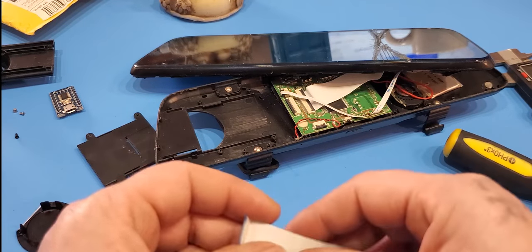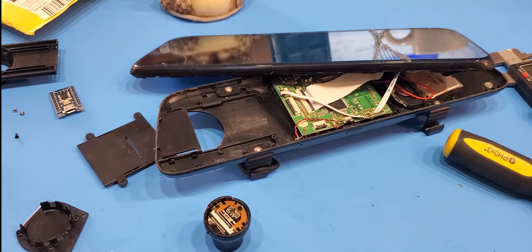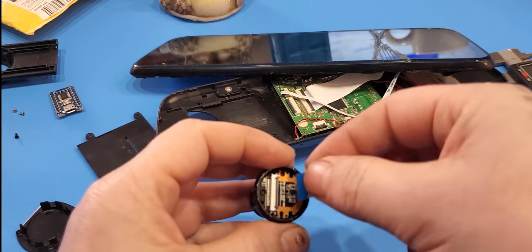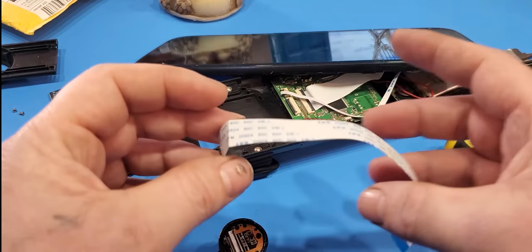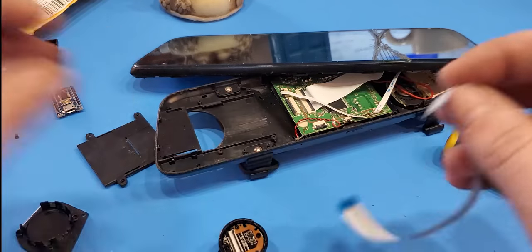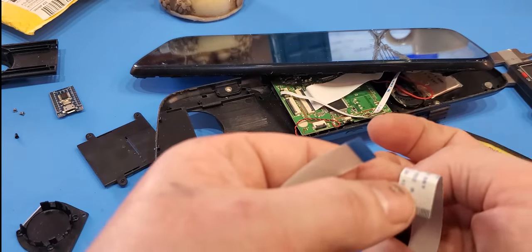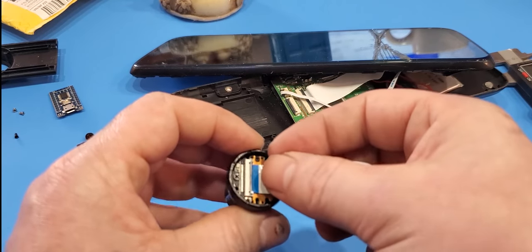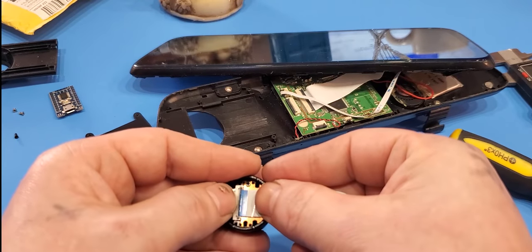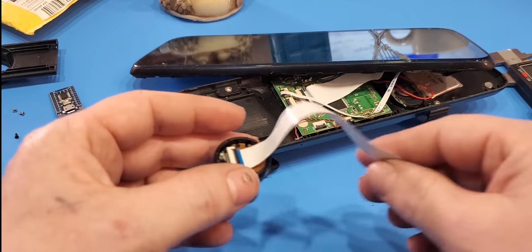Here's a new cable. It's simple — just reverse all the steps. This one might have a crease in it already, but I'll go with it. To stop this from happening, I would suggest never pushing the camera back and forth, which causes the cable to bend and break.